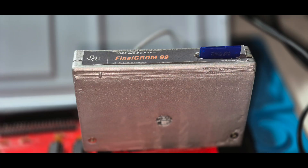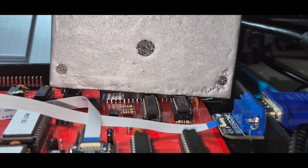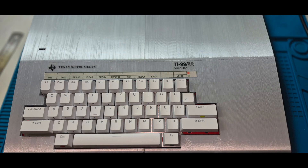Modern components keeping the vintage design alive. I had wanted to test out using a cartridge or two, but I've got three problems. Firstly, the TI-9922 is built on a design similar to the quality-improved version of the beige TI-99 4As, which means the Final GROM 99 cartridge won't work — and unfortunately that's the only one I've got. Secondly, and perhaps more importantly, it doesn't fit: the IC socket with the IC on top prevents the cartridge from sitting correctly in its socket. We obviously need some kind of extender for the cartridge socket. Lastly, there's no slot for the cartridge on the TI-9922 case — we'll have to cut one in when we eventually fix that problem.